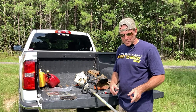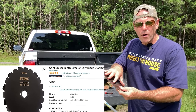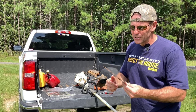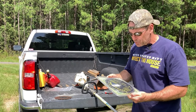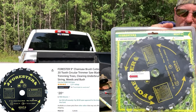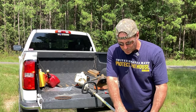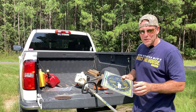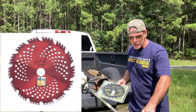The original blade I got is the steel blade — it's worn out after five or six years and has no numbers or color, just chainsaw-style teeth like a skill saw blade that you sharpen with a chainsaw file. Another option I have is called the Forester, a nine-inch saw chain grass blade with actual chainsaw teeth riveted on it — bigger than what's currently on the machine. I haven't used it yet and am not sure I have enough horsepower for it. My favorite so far has been the Razor Hybrid carbide-tipped blade.